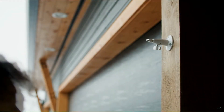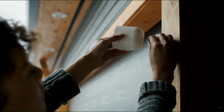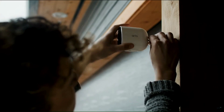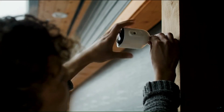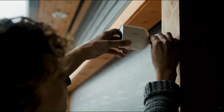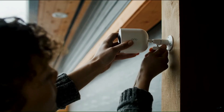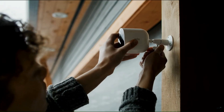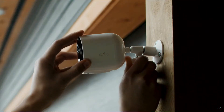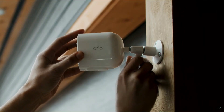Let's adjust what the camera is pointing at. It may be that the camera is looking at a busy area, causing it to pick up several movements. Make sure the camera is looking at areas of high importance, and locations with a lot of movement, like a busy road, are not in view of the camera. If the device is located in an area where you cannot adjust the positioning, we would suggest using an outdoor charging cable or a solar panel to assist with battery usage.